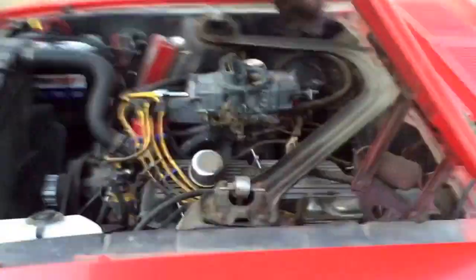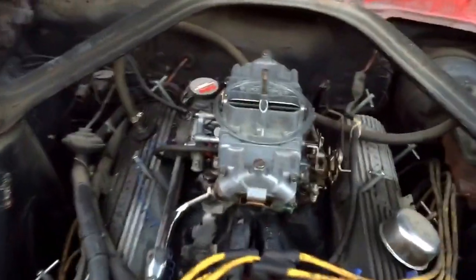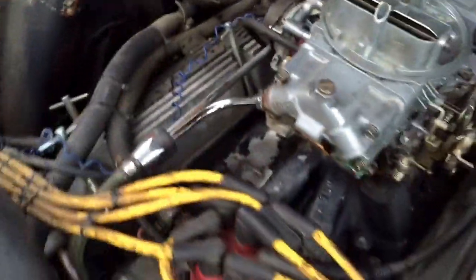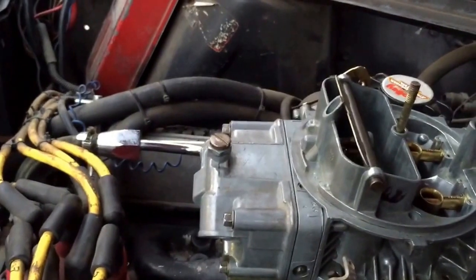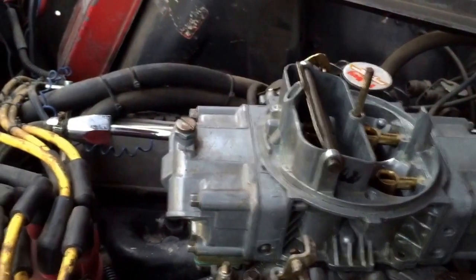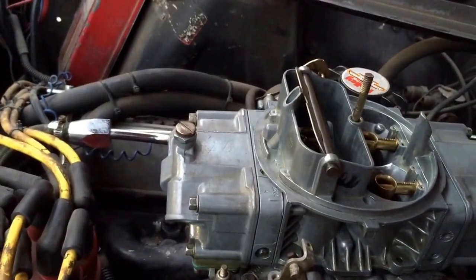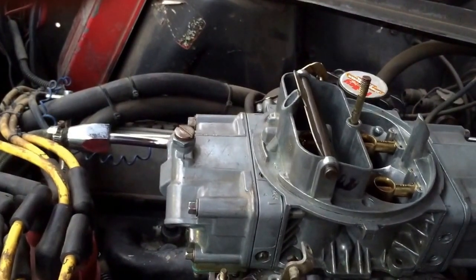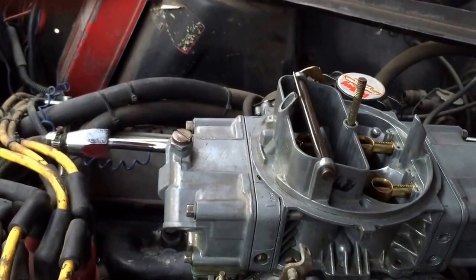I'll turn the key and you'll see the choke coil get power — in my case via this cord directly from the 12-volt battery. When you start the car in the morning the choke is a little more closed than this, creating high vacuum because it's a restriction. As the car warms up — or rather as the choke warms up after a few seconds, like a timer — the choke plate starts to move. You can see it there, it goes open.